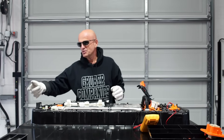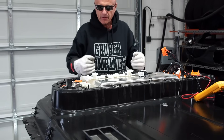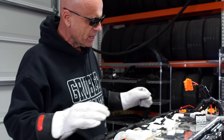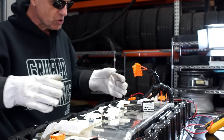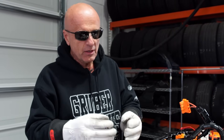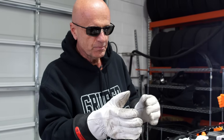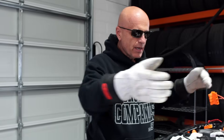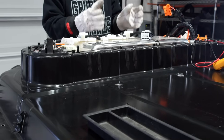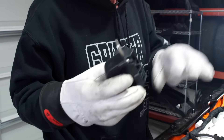We've begun to take this Model 3 lid off with most of the caulk opened up around it. I have my PPE gloves on — we're working with high voltage at this point. We took the penthouse cover off and here are some of the electronics; this is the charger for the Model 3 battery pack. I've just disconnected the pyrofuse. There are four module sections running the length of this battery pack, each at 100 volts. Two are connected in series here, two here, and they are bridged with the pyrofuse giving a total of 400 volts. By removing the pyrofuse, we split the battery pack into 200 and 200 volts, which is a bit safer.